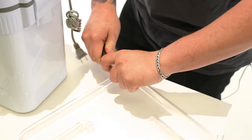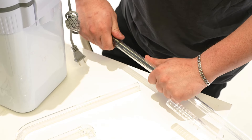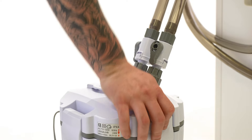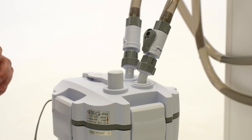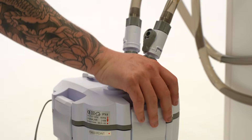While the Delta 30, 60, and 90 have half-inch tubing, the Delta 120 is the only filter in the lineup with five-eighths inch tubing. To begin priming your filter, press the plunger a few times until you start seeing water moving through your inflow pipe. The water level should then equalize against the glass of the tank. The Delta 90 and 120 also do not need to be full of water before you begin priming.